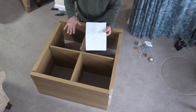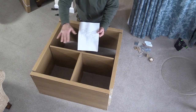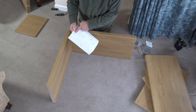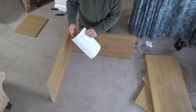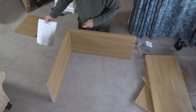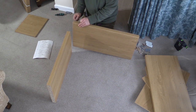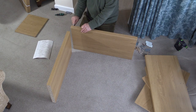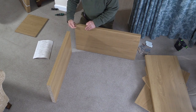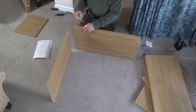I've replicated that here — there's no need for you to do that. But it's a very good idea that you understand where all the pieces fit relative to each other. So our first step is to take two of these long screws plus the little tool they supply and assemble one pair of pieces. This screw is going in from the outside here, and I'm now going to use this tool to help it get going. A good tip is just let the end of the screw stick out through the hole a little bit, and then we'll do the lower one.